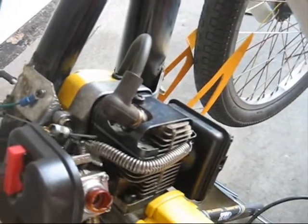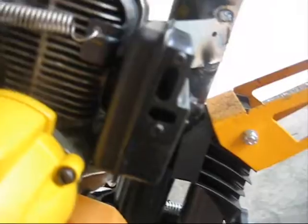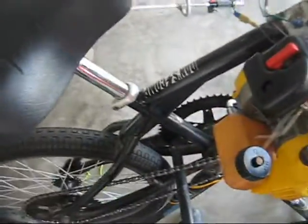But I hooked up my throttle. You can see there I just drilled a hole lengthwise through a bolt, put the cables lengthwise through the bolt, and then tightened them down with a nut. And now it works just fine. And I put an extra spring on there, just connected to the little heat shield there. Nothing special. Got my kill switch wires. Just goes to a ground there. This just goes to the coil and up to my switch. Let's see. I put in one more hole in the exhaust, I didn't want to start out big, you know.